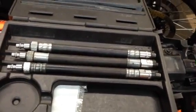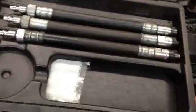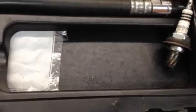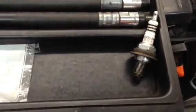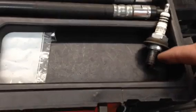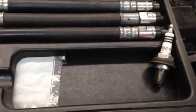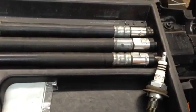These gauges usually come with adapter hoses for different sized spark plugs, so the first thing you have to do is make sure you have the correct adapter. Almost all modern two-strokes use an E-series spark plug — right after the number is the letter E. This spark plug is a BR7EIX, and there are also BR7ES, BR8, BR9. If they have an E after the number, that's a three-quarter inch plug, meaning the threaded area is three-quarters of an inch long. You have to have the matching thread length on your adapter. I've already got it in the engine — this is a half-inch one here. If you use a half-inch adapter in the head, the head will have more volume at that point and the compression reading will be low. So have the right equipment.